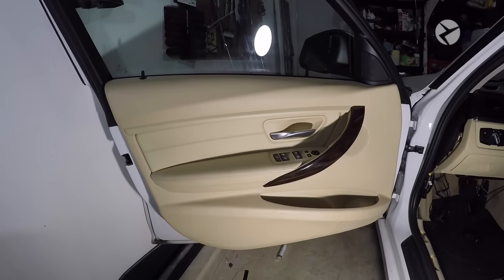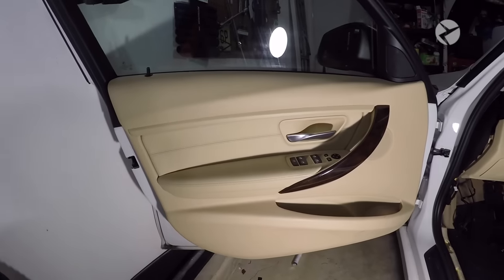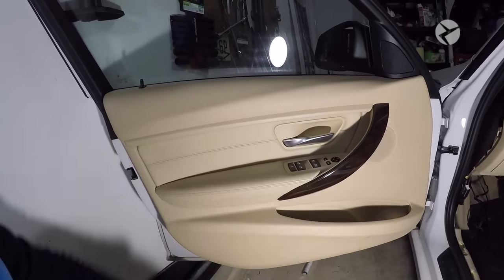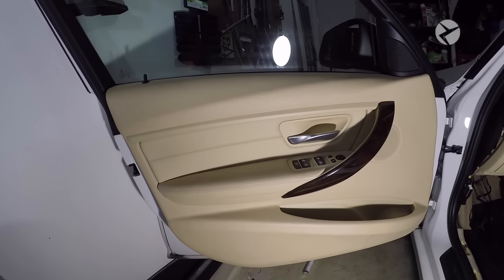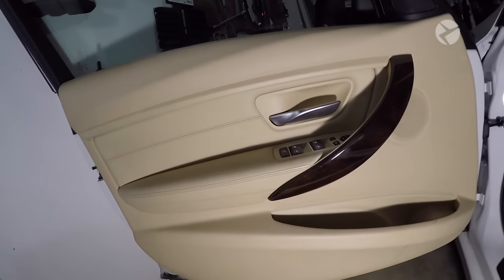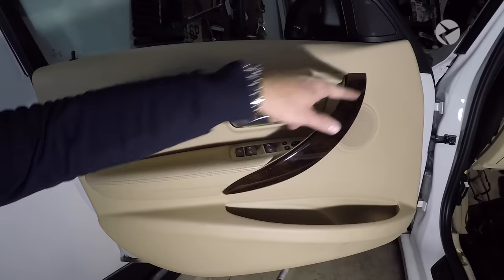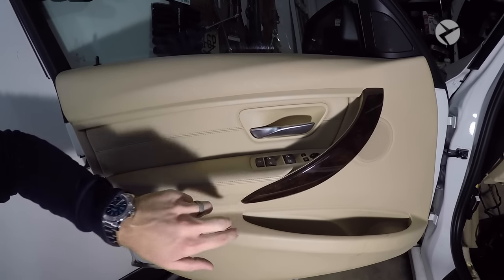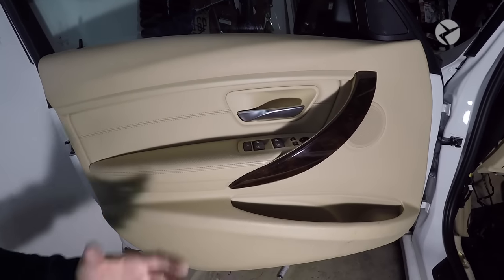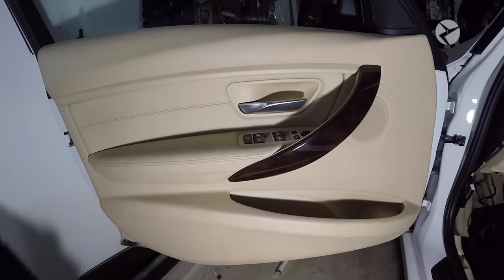At this point we're ready to remove the door panel. We need to remove the wood trim — some cars have plastic, some have metal, but mine is wood and it's very fragile. I'm going to show you how to remove the door panel and specifically this piece without damaging it. You'll notice there's a small clip up here and a larger clip down here. Always clip the top in first and then snap it down. To remove it, do the opposite — remove the bottom first and then slide it out from the top.